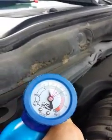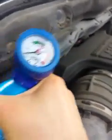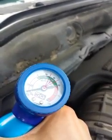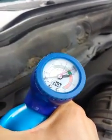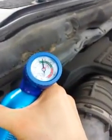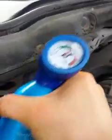And it can need a charge there, so you just pull the trigger, shake a little bit, the can will start getting cool, and you want to get it between those two red lines that we adjusted for the temperature. So it's hard with these new systems, it's pretty hard to overfill, but give it a shake. You'll hear the engine kind of pull that in. It may take a bit.